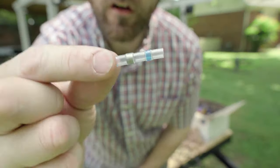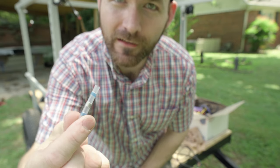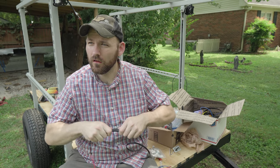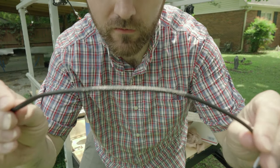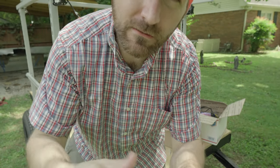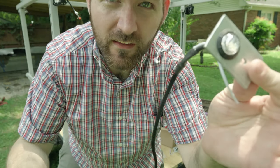Now I'm 100% sure I wired up those lights wrong. These things right here are pretty cool — they're heat shrink with solder. You put the wires in there and just heat it up and they solder your wires for you. I don't know why I just now discovered these but they're awesome. I also really like this nylon sleeve — it expands and you can cut it to length. I don't do it properly; I just cut it and light it with a lighter. Then I heat shrink everything together and that's pretty much how I did that.